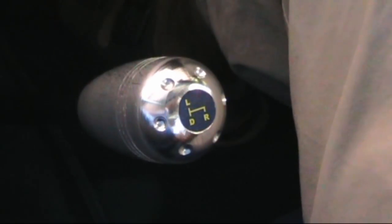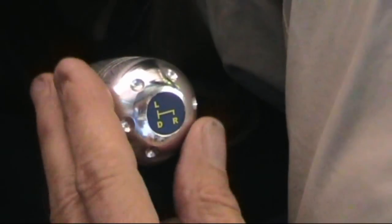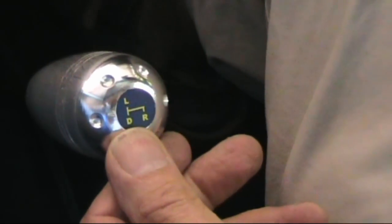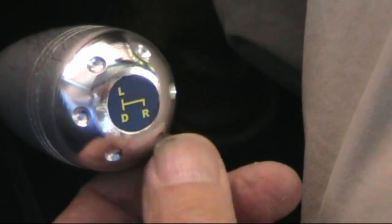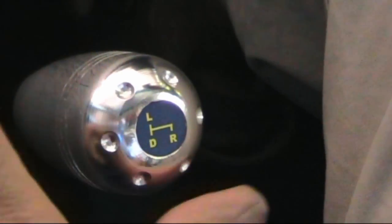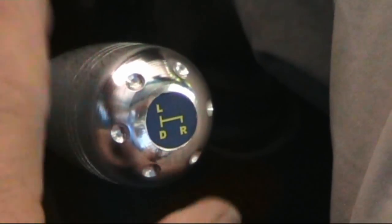One of the other differences is we've modified the gear shifter lever so that first and second are locked out. So it's really fourth gear and that's all I've ever used — I have allowed third gear to be selected but have never actually used it. It's basically fourth and reverse from the original gearbox. In the first videos we had a problem misselecting — we selected second gear, which over-revved and the rev cutout came in during our first test drives. This modification gets over that sort of problem.